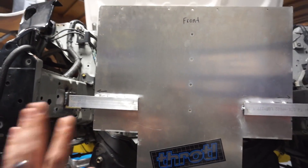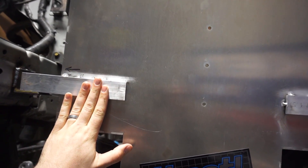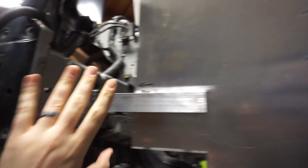Mickey went ahead and fabricated the mounts out of aluminum that are going to be welded to the battery box, and we also tacked in the brackets that mount to the chassis. So everything is just tacked into place right now. We're going to start on the rear mount and once that's done, we'll pull everything out and do the final welding on everything. Already this thing is freaking solid. I'm pretty stoked on this design and think it's going to be plenty strong for what we're doing.